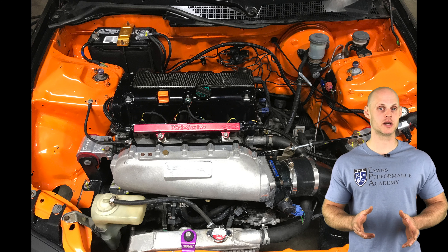The parameter section covers map sensor info, fuel injector info, throttle position scaling, sensor setup like fuel pressure and oil pressure. Moving through the tabs, let's jump to the Advance tab first. This relates to deceleration fuel cut — when you lift the throttle, it shuts off the injectors. Because this engine has the larger Drag Cartel 3.2 cams and larger injectors, I'm going to raise the deceleration cut point up a little bit.